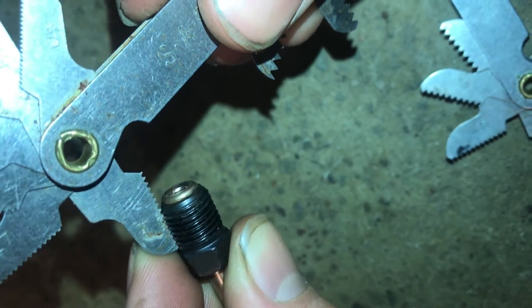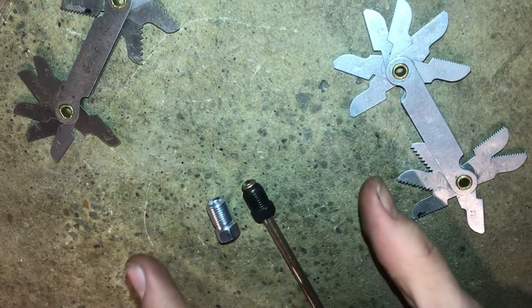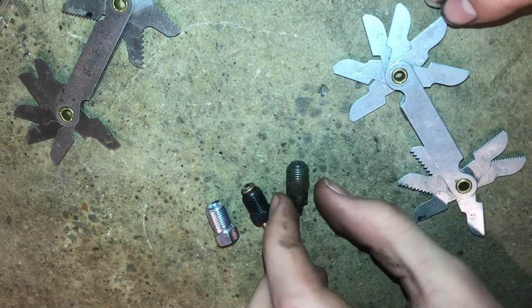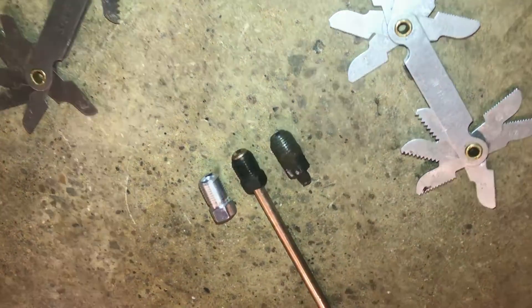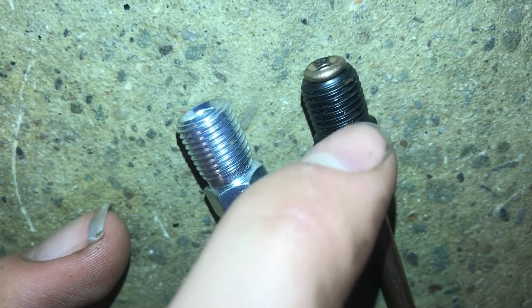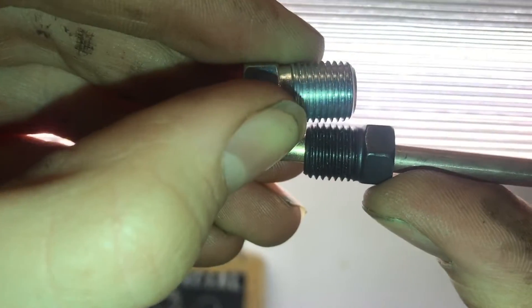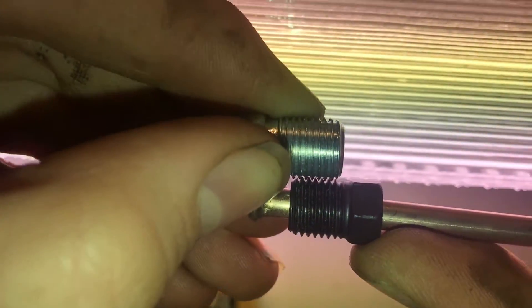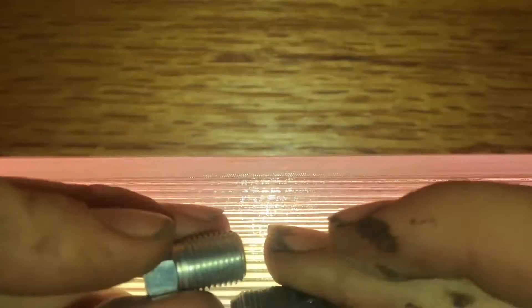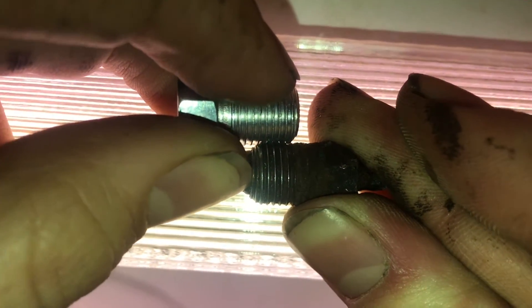If I try to fit the other fitting on the 1.0, it just doesn't fit as nicely — it fits the 24, right there. So these threads are slightly different. If you try to put the wrong one in, it won't thread in — we've done that before, and it'll totally halt the brake job. This one is metric, and this is the standard American: this is a 3/8-24, and this is a 10mm 1.0. You can really see the difference — light goes through where they don't mesh. But if I take the old fitting and the new fitting and put them together, they mesh perfectly and you almost can't see any light behind it. That's what you're looking for — a perfect fit.